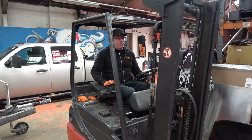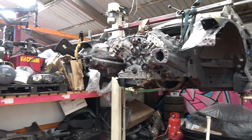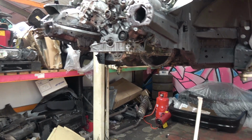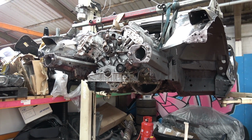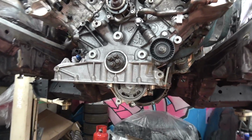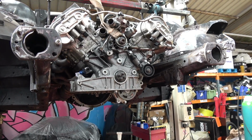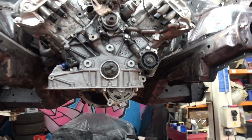We'll have to test you, but we are about to remove this big fat pig. Bolt the sump to it and take it around to Craig so we can weld it up. The only reason we're bolting that to that is so that we don't warp the flange on the sump, because that would suck. We don't want to be playing that game after all this. We're going to weld it in place, and Craig was definitely not coming around here to weld it, so we'll do what we can, no matter how much tea we're making. Take the pig to the farmer.